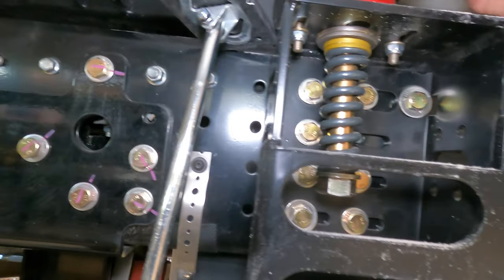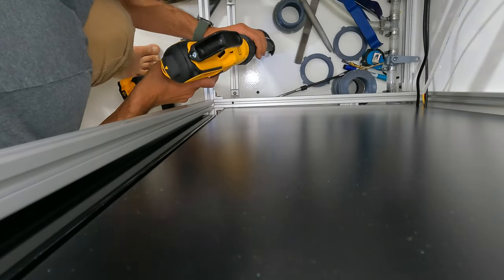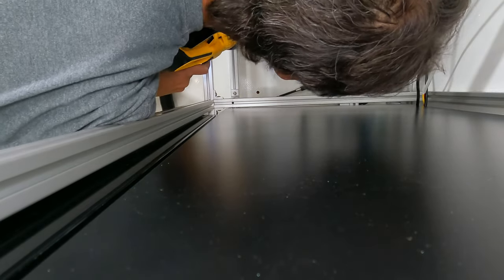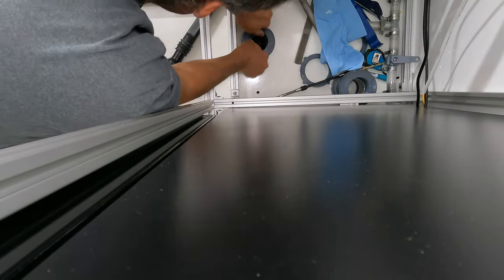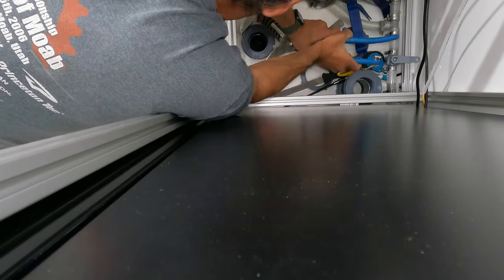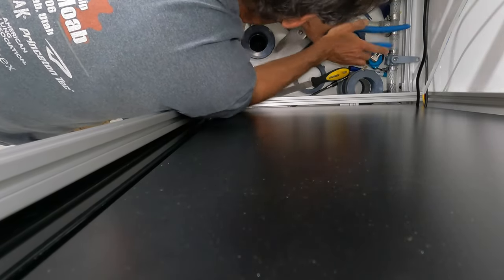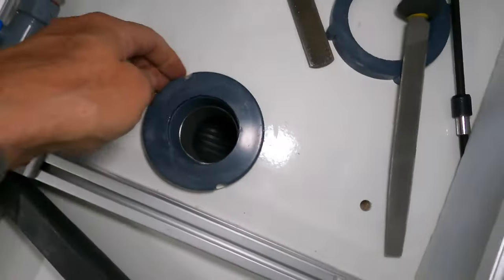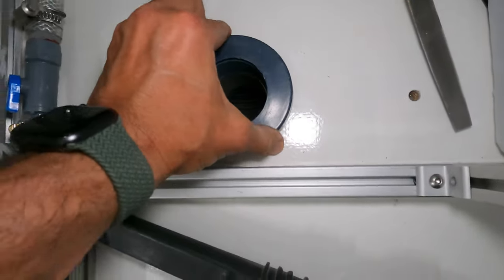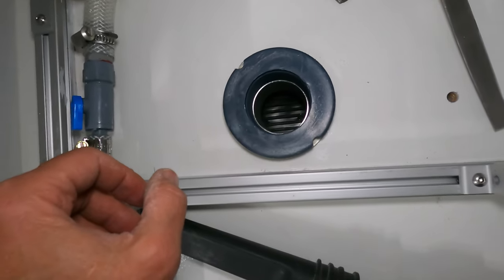It's going to go in just barely — we got her in just barely. Now I'm using an aluminum nipple instead of a PVC nipple like on the other ones, because it's not plumbing — it's going to be for AC compressor hoses and wires that are a bit thicker, and an aluminum nipple is thinner in wall thickness. The reason I use adhesive sealant around the nipple and bulkhead fittings and between the floor is to make sure it's watertight and thermally sealed. Look at that — fully sealed, gasket compressed, nice tight solid connection. That will be water and airtight, except for the opening which will of course be sealed up. Complete and done.